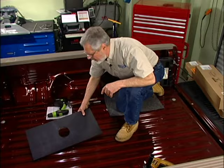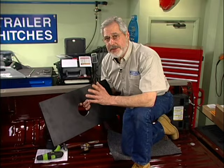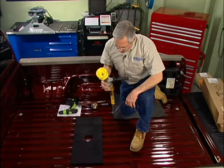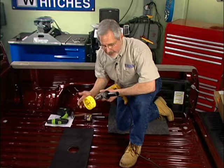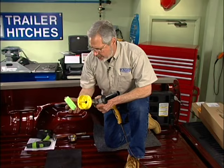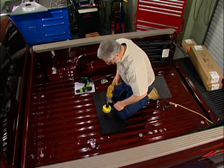Once you've got that done, here's a neat little device you may want to make: a piece of three-quarter inch plywood with a four-inch hole drilled in it. It's easy for a hole saw to walk around, so you set that on there. Once you put your hole saw in place, you can stabilize it. This is a Starrett — they make really good hole saws. Here's a tip: if you take a sponge and cut it so it fits inside and put some cutting oil on there, you've really increased the life of the teeth on your hole saw and it'll make it go a whole bunch better. I'll put a little bit of lubricating oil on it and I'll be ready to shoot this.